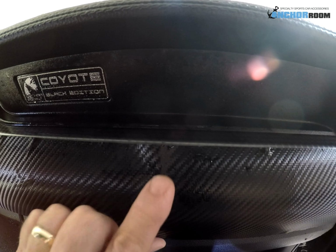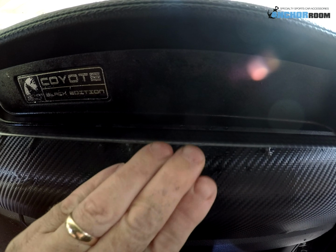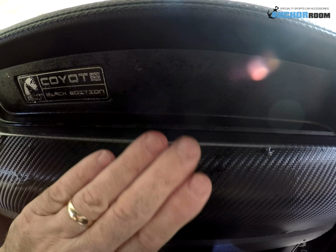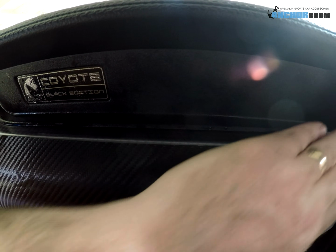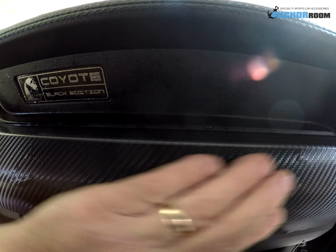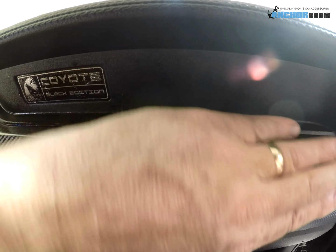We're just going to add a little bit of heat, and we're literally going to move our thumb. What we're doing is tapering the material to the surface that it's on, which is obviously three-dimensional. But more than anything, when we're moving the moisture from underneath the dash, we are immediately evaporating it, and that's without a doubt what's doing the job here. As you can tell, look at that, perfectly straight. All those fingers are gone. Now I'm just going to use a squeegee to get the areas completely flat and get that excess moisture out.